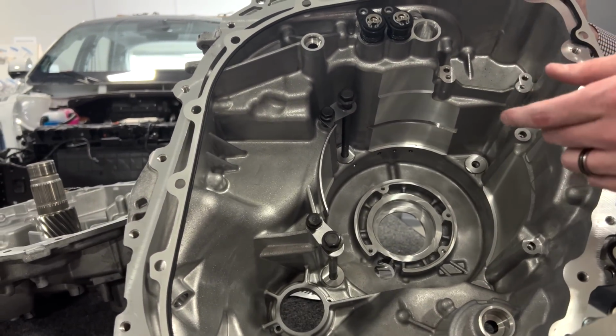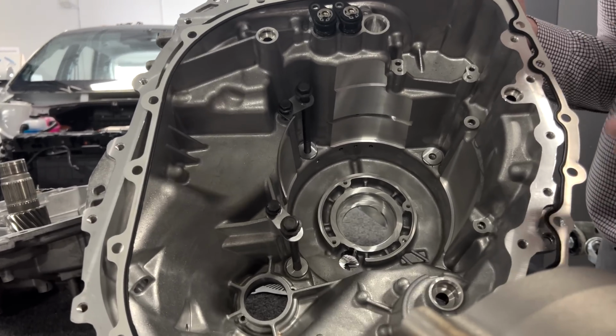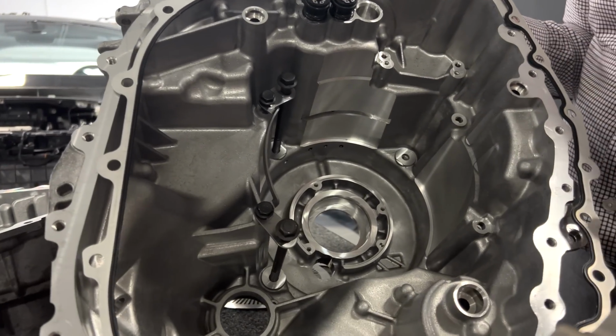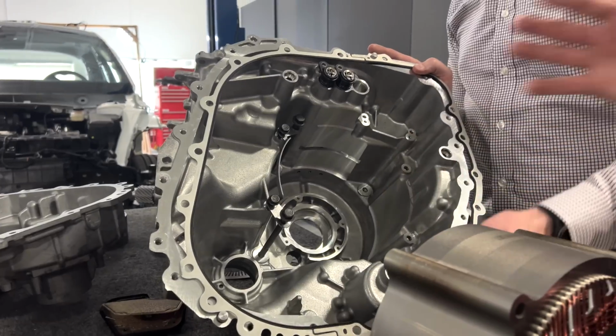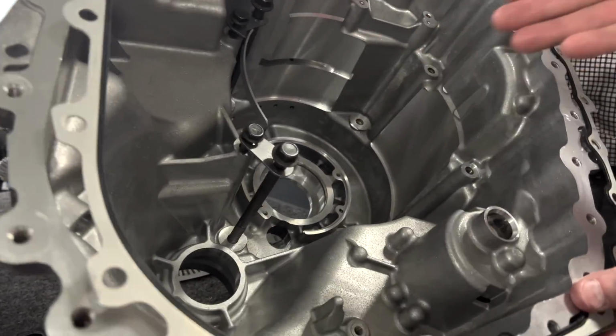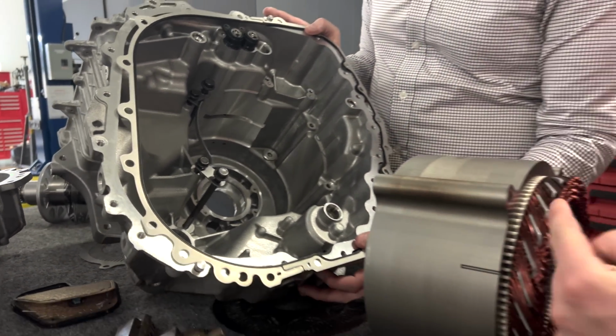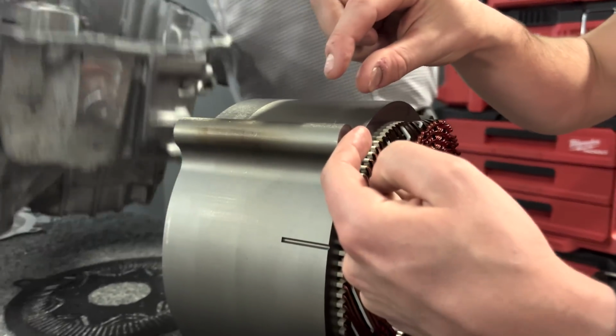So this is something that's interesting, and it may simply be certain requirements that are in place that drive this cost and complexity within assembly. It's something that we actually see on cradles and subframes of the vehicle, right? Where you take essentially a shear plate, which is what you get here, and it lays over the top of these ears of the stator and it bridges to the casting.